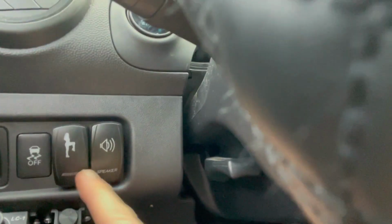Okay, so you guys might notice that I've got two of those relays under that dash. You're right. One of them is the circuit that I demonstrated that I'm using to power my lights. The second one is what I'm using as a remote turn on for my DSP under the seat, the 4-channel amp under the passenger seat, and then these two turn on lights here.